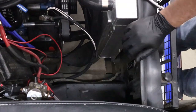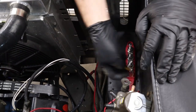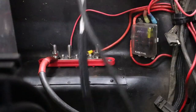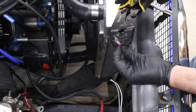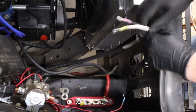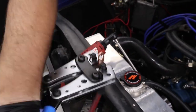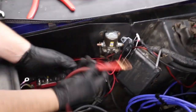With the battery removed and the bracket replaced, I can now put in my breakout panels. I want a positive and a negative breakout right here at the front of the car, and these little panels I found seem to be great. They're essentially a series of studs on a nice metal plate with good insulation characteristics, and they have these nice little cover plates held on by nylon nuts — a very good solution for the general aesthetics as well as practicality. Most of my cars are not show cars, but driving a car regularly comes with the hazard of breaking your car regularly. So when I'm laying out my wiring, it's either temporary so I can test it before bundling it into a harness, or it's going to be something I can service alongside the road with a couple of wrenches in the middle of a pouring down rainstorm. These panels allow me to, at spur of the moment, add or subtract things from the wiring in the front of the car with basically nothing but a small wrench.